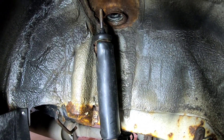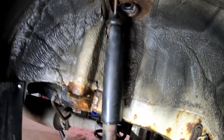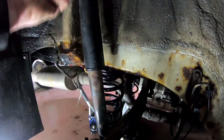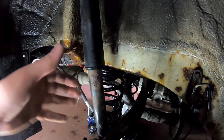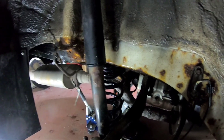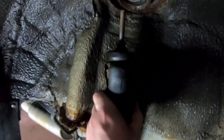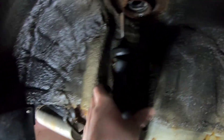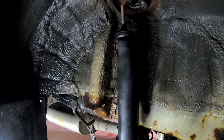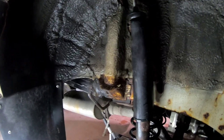I'm just going to make this spacer for the top for the shock there — it's just so it'll bring it down a little lower, because before the shock was stretched all the way out so it wouldn't allow everything to come down. And that's probably what broke the coil, and there's 300,000 kilometers on the car. This threaded part sticks out into the trunk about two inches, so I'm going to cut a piece at two inches, weld the washer on it, and then put it in there and see how much thread I have at the top, and then I can just trim it off from there.